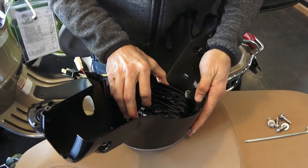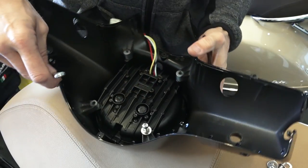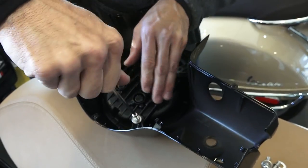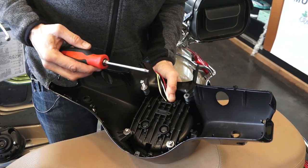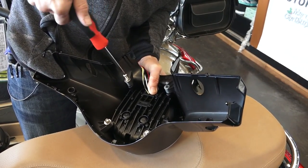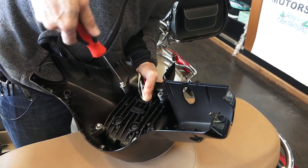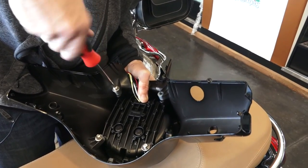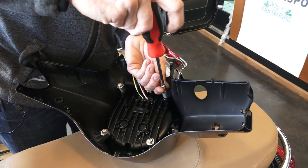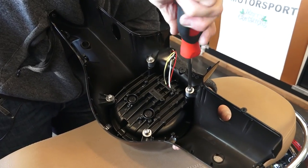Go ahead and rest this on a soft surface and start by getting all the screws started. Include the washers. One thing about these screws — they're a little larger than the standard screws that came with the scooter so they may need to thread through the plastic, but no need to get a drill out. One trick to speed up installation of a 4mm Allen key is to use a T25 Torx screwdriver, which happens to fit perfectly in a 4mm Allen — just don't use this for the final torque. Keep the other two screws not all the way tightened; you just want to get them all started first. It's always important when installing an item with multiple fasteners to make sure each one starts threading into the aluminum headlight housing without cross-threading.